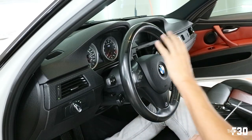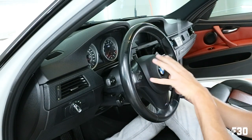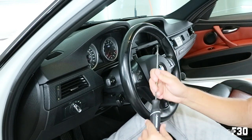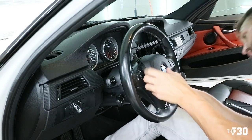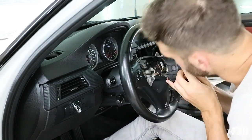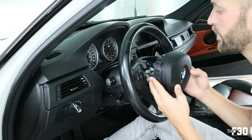Now that's working, on to the fun part — we've got to take off part of that steering wheel in order to get the M button on. Part of that means I've got to pull out the airbag, which is kind of a pain but it'll be worth it. In order to get the airbag out, we're going to use a flat head. There's basically a little spring in here — this is spring loaded, similar to how the F30 airbag is set up. There's a slit on this side and a slit on the other side. This is going to go in and we're going to try and hit that spring and pull out each side. You just want to be careful when you're stabbing that you're not going too far in.